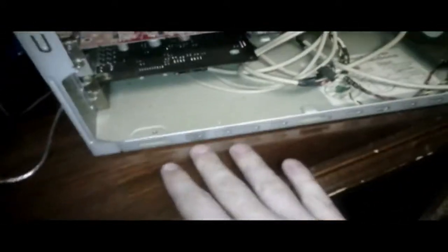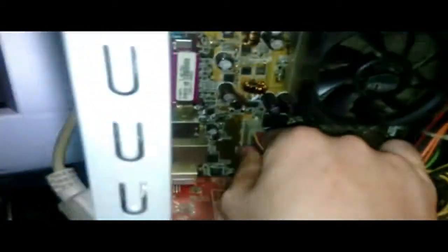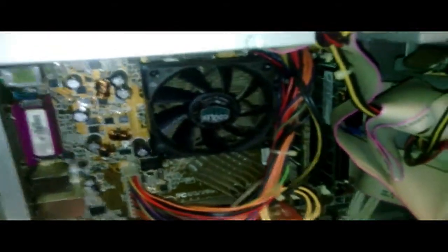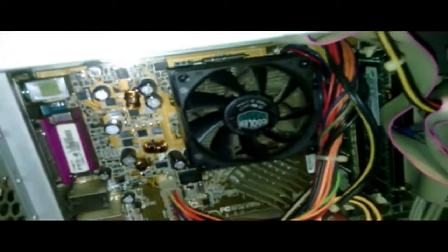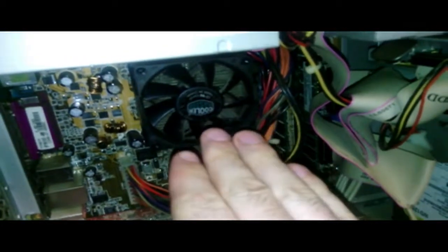What I do is I wouldn't even hard install the donor power supply into the computer — I'll just set it down to the side and plug in just the bare essentials: the motherboard and the hard drive. If the computer still doesn't power on with the test power supply, and you know the power supply is good, then that's where I would really strongly suspect that there's something wrong with the motherboard.